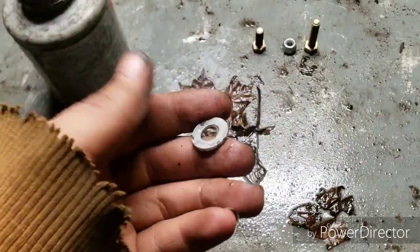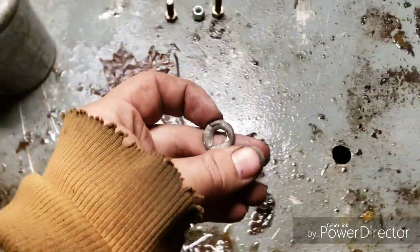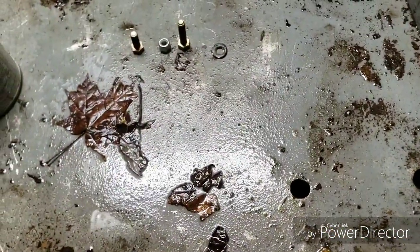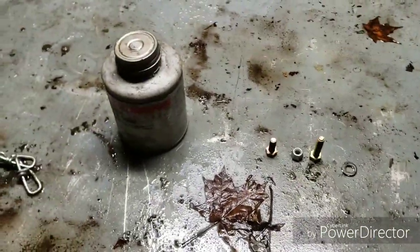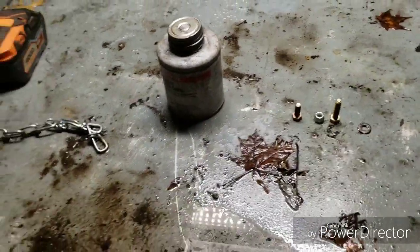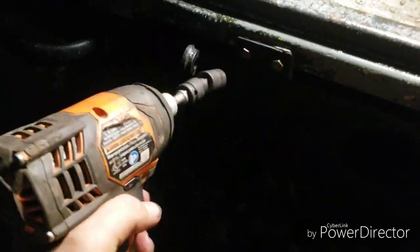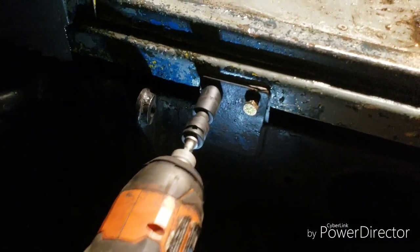For washers on the back, these are plain galvanized washers. I'm taking a little bit of butyl tape and smearing it around the outside, using a heat gun as a heat source. That way when it compresses on the backside it keeps that end watertight. Might be a pain to pull off eventually, but it's not the most difficult thing. I'm anti-seizing it with some nickel anti-seize — that's why I'm not using copper slip or anything. Hopefully it'll be able to come apart next time easily. The heads are 13 millimeter.